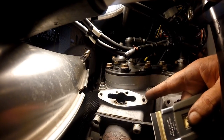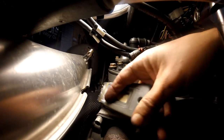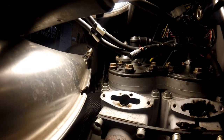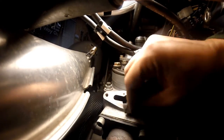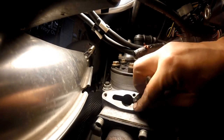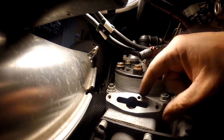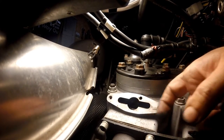I'm ready to go ahead and get the exhaust valve back inside the cylinder. I'm going to take my flat razor here and just clean that face right there, make sure it's nice and clean so my new gasket has a good seal. I'll maybe use a little bit of steel wool, kind of run it around the outside, rough it up. It cleans it real nice. If you get any debris inside of this slot, the best thing to do is clean it out with your finger or maybe a rag. You don't want any of that steel wool to get down inside that shaft and affect the movement of your exhaust valve.